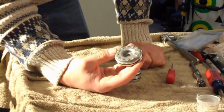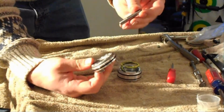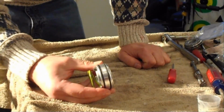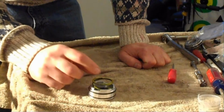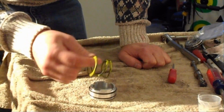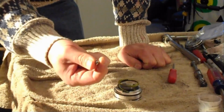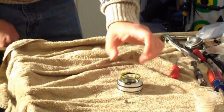Here we got the original 4th accumulator piston. Went ahead and pulled that out. It had a guide pin with it as well. Pulled the pin out, pulled the piston out, discard the pin, discard the piston. Got the Sonnax pinless 4th accumulator piston. Went ahead and installed the D-ring, the PTFE ring, per the Transgo kit. Took out the old spring, replacing it with the yellow spring. And then we'll slide this back up into the case of the transmission. And before you do that, install the large ball bearing that came with the kit first, and then the piston second.